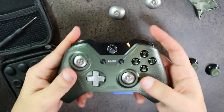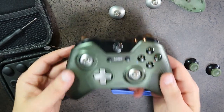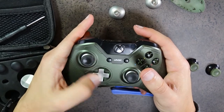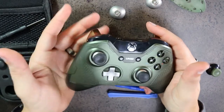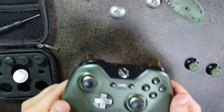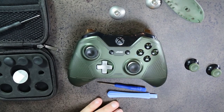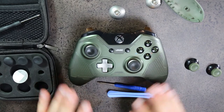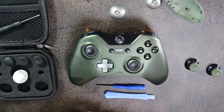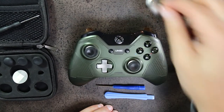That's it — everything is put back together. At this point, put the back grips on. Before doing that, I suggest trying a game out to make sure everything is working, especially if you were unsure about left trigger interference. The grips at the back are actually the hardest thing in this entire process, but really not that bad. We have now upgraded the Xbox One controller to magnetic sticks. This should take less than five minutes, maybe ten if you have trouble with the grips. The most important thing is making sure you get the correct magnetic sticks.